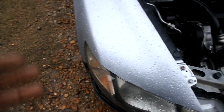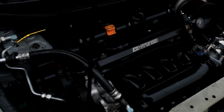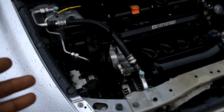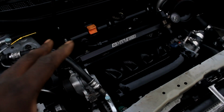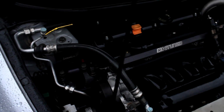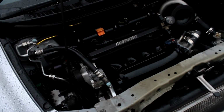I thought the tires were an issue, which I need better tires. I do have the radials, and it won't hook, so obviously it will spin. But the vibration was kind of throwing me off guard, because I have Energy Suspension bushings, lower control arms and everything, so it's stiff. I have Boomer mounts. So I don't see where this vibration came from.